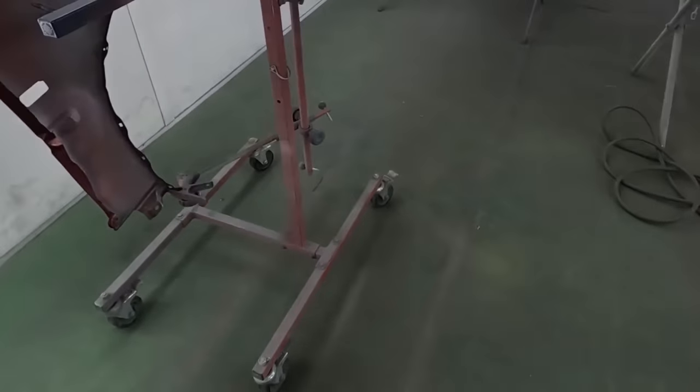With the doors all completed and dry, as well as the underside of the hood, it's now time to start the cut-in on the actual vehicle. Now the cut-in or the jam is painting the parts on the vehicle that cannot be painted once everything's assembled. Once again, on this particular vehicle, we're gonna be painting the whole car together because it's a very complex color and we don't wanna risk panels not matching up if painted separately. So it's always gonna be best on your complex colors, especially this one, to paint everything together.